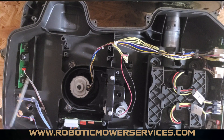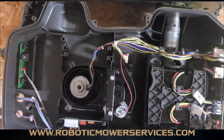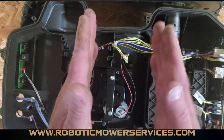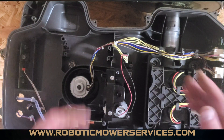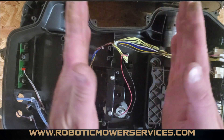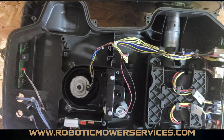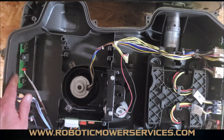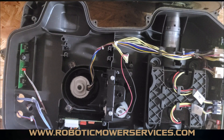What this board does — it's a loop sensor, so it picks up the signal coming from your boundary loop wire and your guide loop wires. Because it's in the front of the mower, this is the board that, when the mower enters a narrow corridor, senses that the wires are coming together and tells the mower to get skinny — we're going into a tight area. There's also a loop sensor in the main board on the back of the mower. When the front one says get skinny and the mower goes through that corridor, the back loop sensor picks up that the wires are getting further apart, signaling that it's in the clear. So it plays an important part in going through corridors and finding the boundary wire and guide wire, since it's in the nose of the mower.